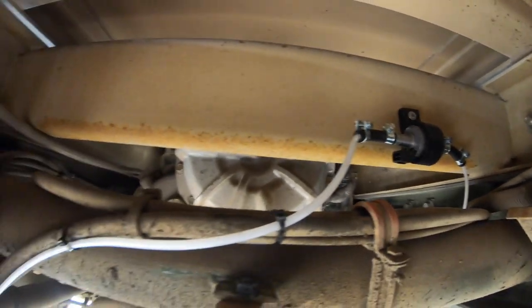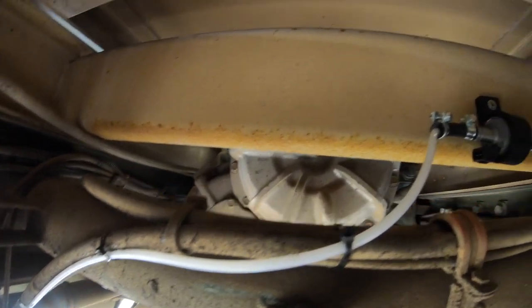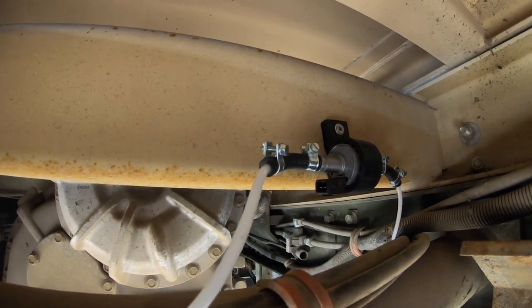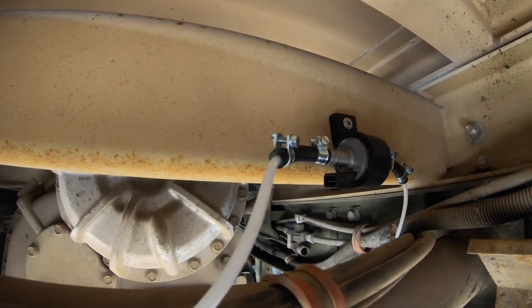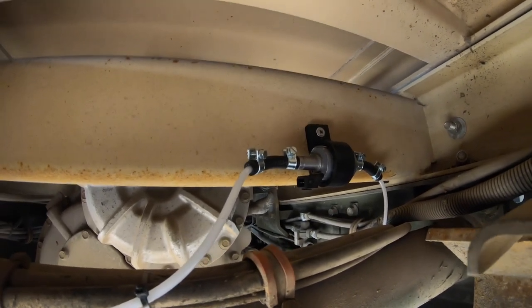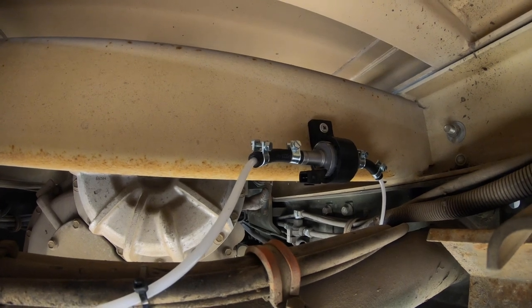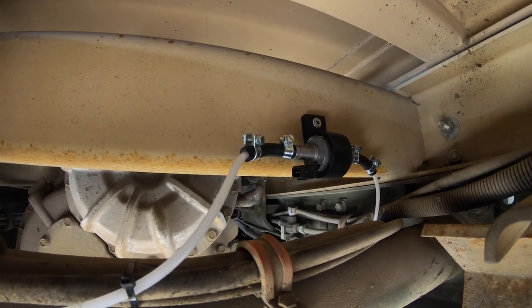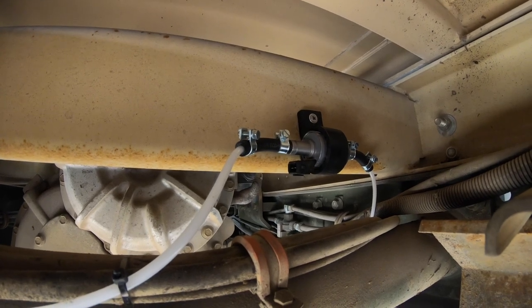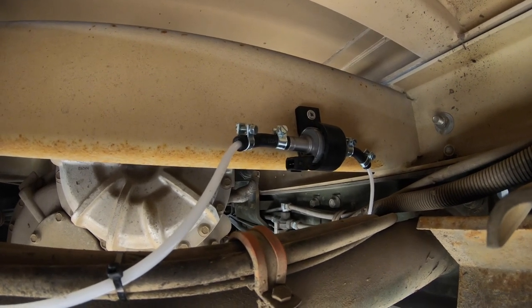Here's the fuel connection I just ran. It comes up this line, goes into the pump, and then out to the tank. Now, these are supposed to be mounted horizontally with only a five-degree tip to them, but they provide this rubber mount that allows it to move a lot. So I think I'm actually going to silicone that rubber mount into place so it won't tip too much. That there is the fuel pump.